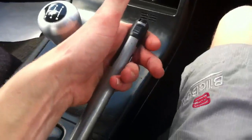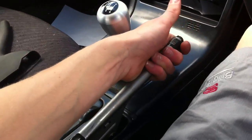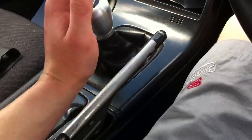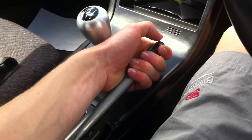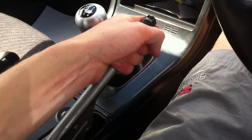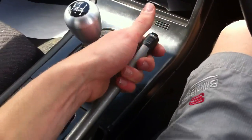I also re-tensioned the handbrake just a little bit. As you can see, my handbrake tension starts there — it used to start a little bit up here and it was kind of useless. The actual full bite of it would be at full extension and you can't really get enough force in there. Now it's there, and when it actually is fully locked up, it's about there — that's pretty good now. To tension it, all you do is just that little nut down there, just pull it up and turn that in. You turn it clockwise to tension it more. I probably only turned it maybe one turn or one and a half turns and it reduced it by a fair amount.